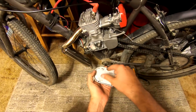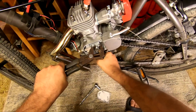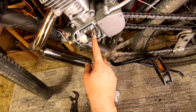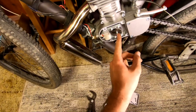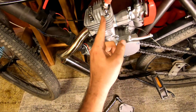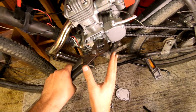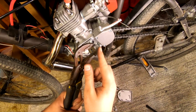We're going to take this cover off. We are going to remove the magnet. Now note this shaft doesn't have a lock washer, so we're going to put some thread locker on it when we're all done. Now note the notch on the magnet — if you move it so that the notch is towards the top, you'll notice that the notch is towards the one o'clock position. If you take this off and you put it back on backwards you'll have spark but your motor will not fire. Usually these magnets come off pretty easy but sometimes they can be a bear to take off and I don't really have a good solution for you. Just work at it and be as gentle as you can because you don't want to muck up these plates.